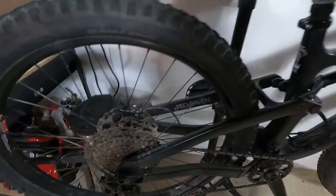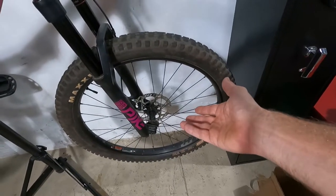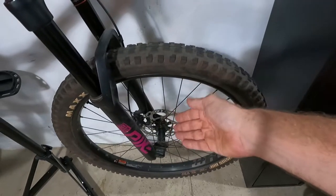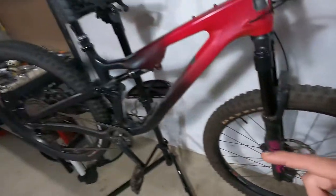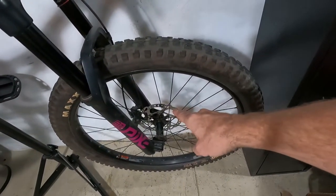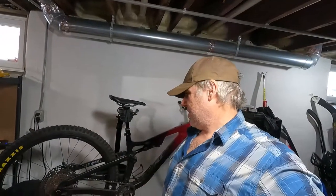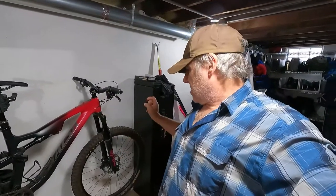I will keep this rotor on here and not change that out, but I might as well update the front one — just to do it for experience. I don't necessarily think the rotor needs replacement, but front rotors do get a lot more wear and usage than the rear on bikes, because this is where 75–80% of your braking power comes from. I'll go over that in another video sometime — I've just now thought that maybe I should talk about that a little bit.